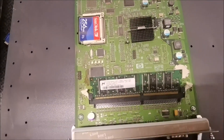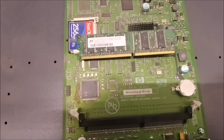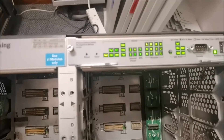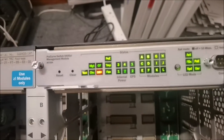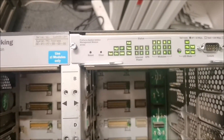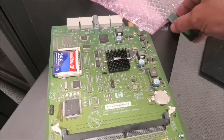It's the old type DIM — quite old. I'll have a look; we might have an old PC laying around. We do have the DIM — actually I think the module's gone. Look at that: we have a green light across the board but we have a DIM missing fault. I'm going to try and find one of these memory sticks — it could be that. New memory came in — it took a while, but they were quite generous and sent me two when I only wanted one.